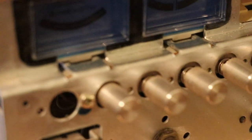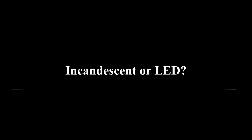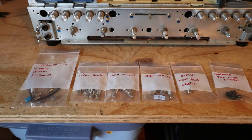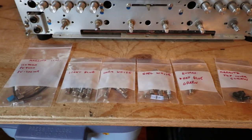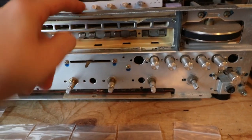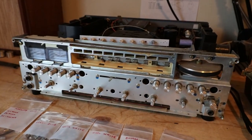There are two little tabs right here that the plastic housing is going to want to set into before you can get these screws to come down. So now that we have this receiver taken apart to where we can replace all of these bulbs, the next big question is: do I use incandescents or LEDs? What color do I use? You have lots of options. To find replacement lights, you could go on eBay or contact Dave at dgwojo.com. Dave is an audiophile who is very passionate about vintage gear and carries just about every bulb you can think of for pretty much any vintage receiver. For the Marantz, he carries everything — incandescents, LEDs, and that goes for both the bipins and the fuse lamps. He even has hardware like top cover screws.